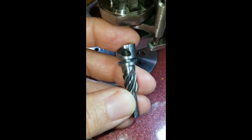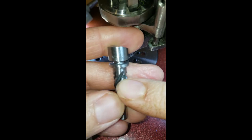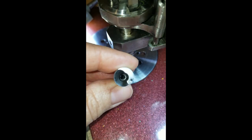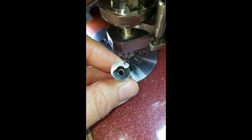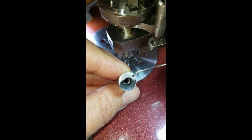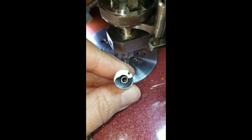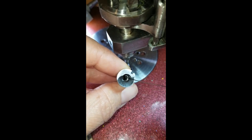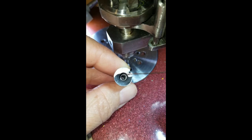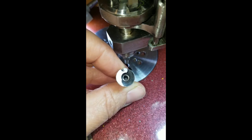It's basically like this, and the worm gear meshes with these threads and it makes it rotate. So when you look down from the top of it, you can see right here is the notch — that's what we're calling the notch in the looper. Your thread comes up through this center hole, you pull it out, and it gets caught in this notch. Then this notch is what makes your thread rotate around and the needle goes down and picks it up.